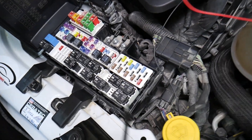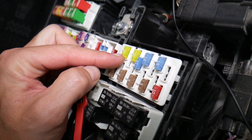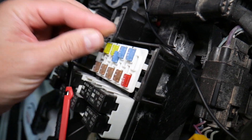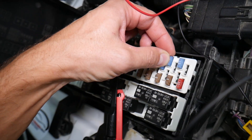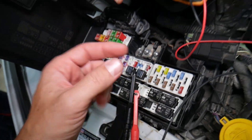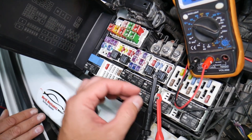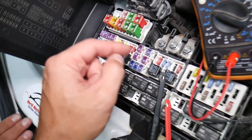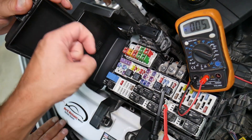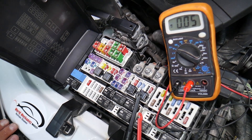It's super important to test fuses. Fuses are not always visibly burnt — sometimes they may seem perfectly fine, you think it's a good fuse, put it back in, and you end up spending money and time on parts and problems that don't exist. All you have to do is test your fuse, find out if it's bad, replace it, and fix your problem. We have a video on how to test fuses and relays — we'll put the link in the description below.